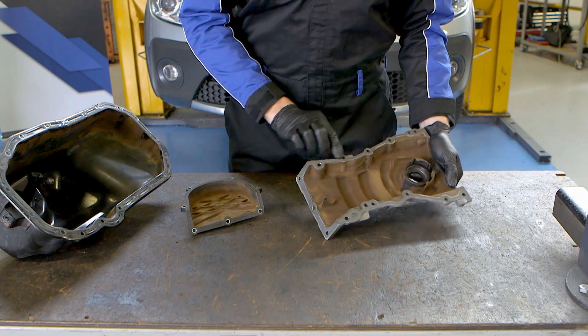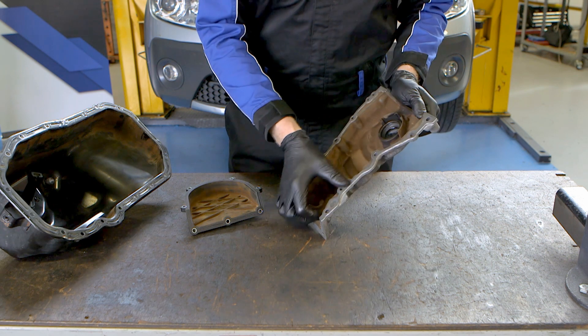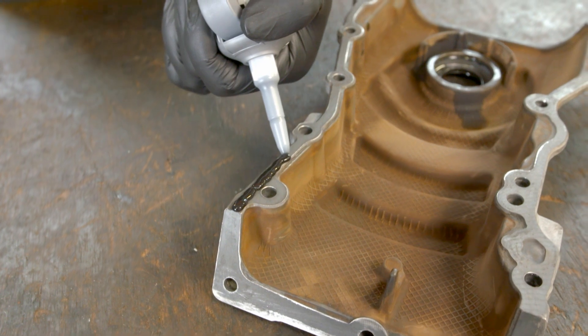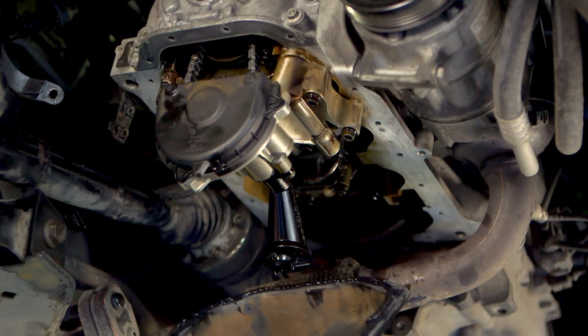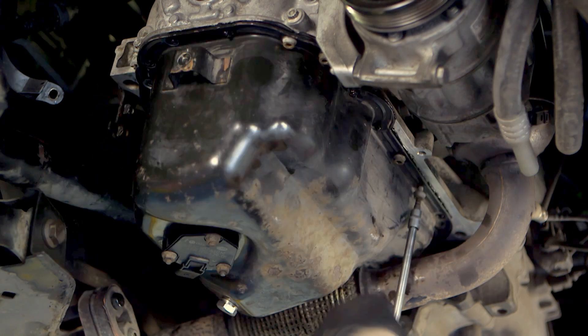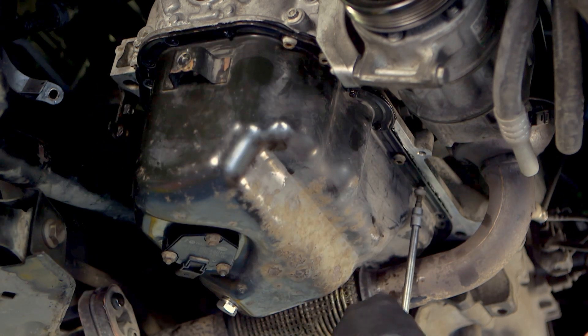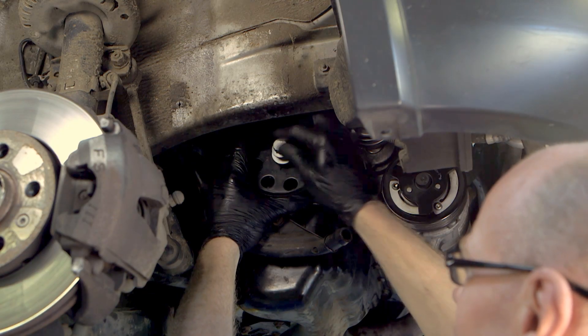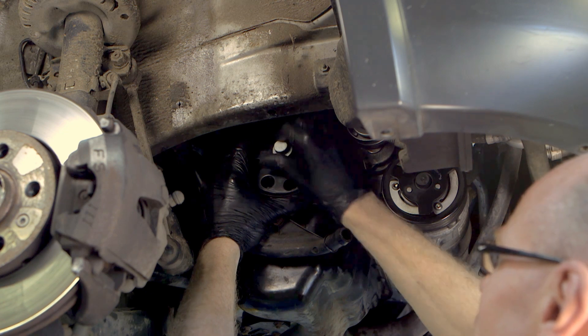With the chain drive in place, all surfaces were checked for cleanliness. The engine sump and timing chain covers had instant gasket sealant applied to them before installation. Then all necessary bolts were evenly tightened to allow the sealant to bond correctly. The engine was rotated for freeness of operation and the engine timing positions were rechecked again for accuracy.